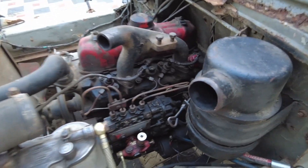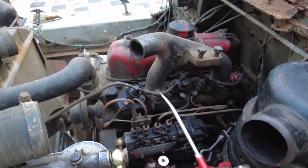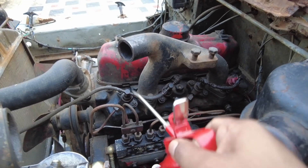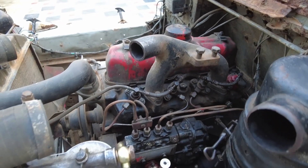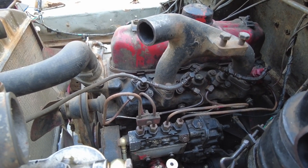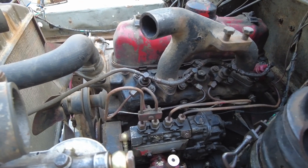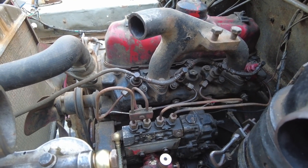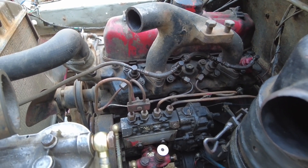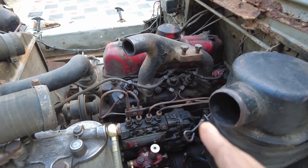Before testing I also used a couple of squirts of oil inside each cylinder to help them seal better, and I think that caused a large increase in the readings. However, in a later test I did it without squirting oil and the compression was still in the range of 450 to 470 psi. So I'm confused about what I'm measuring and whether the gauge is even calibrated correctly — this has raised more questions than answers about whether the engine is good or not.